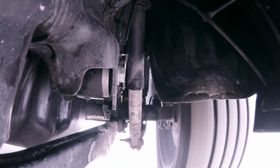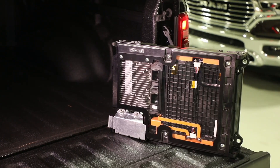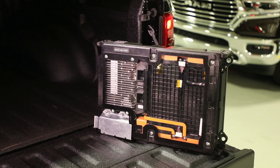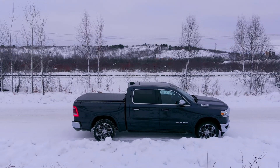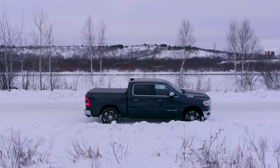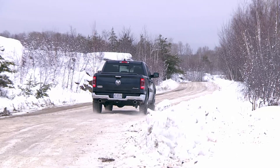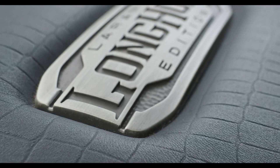So that suitcase battery is designed to be in a constant state of tug-of-war: recharging at virtually all moments when you're not touching the gas pedal, and sending that power back to the crankshaft to boost the engine whenever you are. You might think of it sort of like an electric turbocharger — driven not by exhaust gases but rather by the very action of you slowing your vehicle down, or put another way, boosting performance using a waste byproduct, in this case momentum.